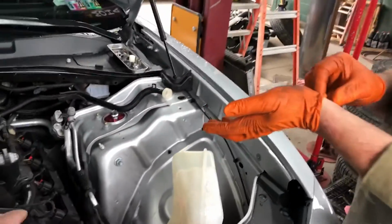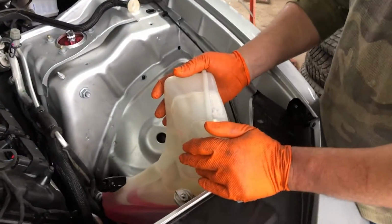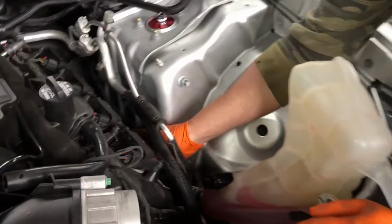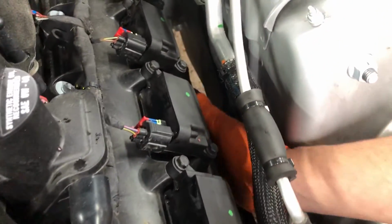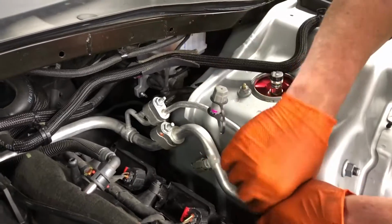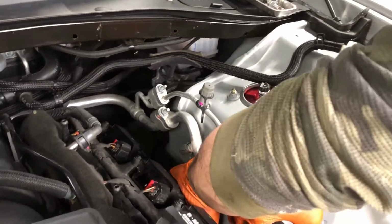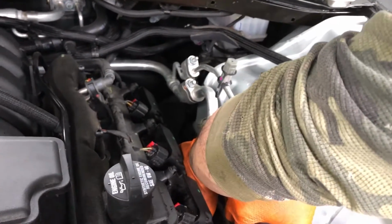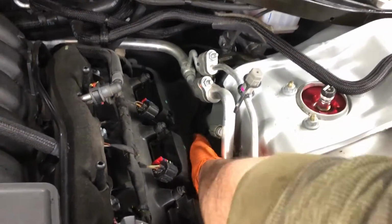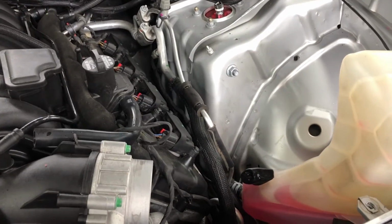Pete got three of the top manifold bolts out. But this is set out of the way, so you can get tools and your hand back there. Loosen these lines by undoing this bracket, and it's only moving that much, but that was enough so that I could get my hand down here and guide the socket onto the bolt. Otherwise, it's a really tight pinch unless you have smaller wrists. Top three, not that bad really.